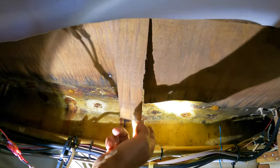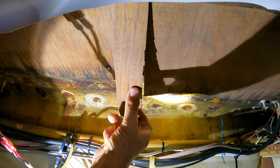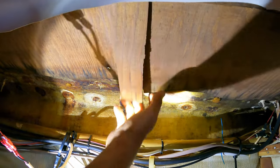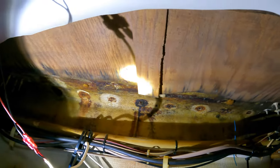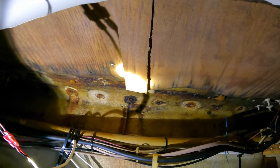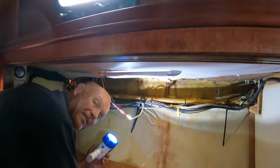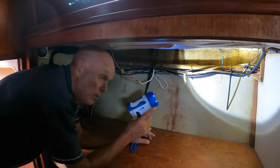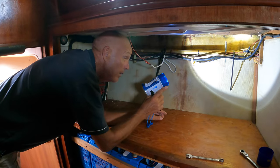This is the area adjacent to where most of the leaking was happening. The old plywood is completely delaminated from moisture — it's all black. We'll be ripping all that out and replacing it with non-wood material. All these holes are going to get filled.